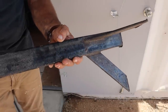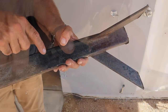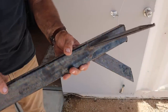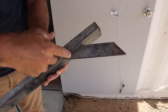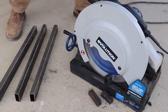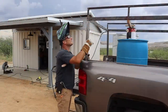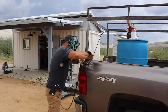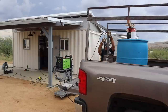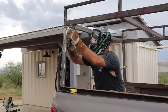The only thing I'm not going to be reusing on this rack are the vertical supports. There is a crack that goes through two sides of one of the vertical supports, and one of the others had a couple of bends - like it had hit a tree branch or a carport. I'm just going to use some new steel, but I will cut these angled brackets out so I can basically use them again as gussets.